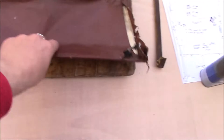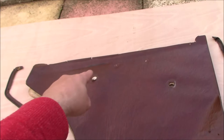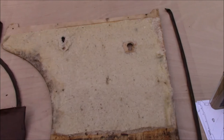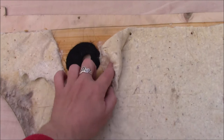Once you've got that off, you're down to your very base fabric — this is the largest piece on the door card. Again, just a few tacks on the bottom, all the tacks around the edge we've already removed, and it's just glued on the top edge. Underneath there is more of your cotton wadding, so that when the fabric's on, it's got a little bit of softness. You've got the door release here, and that one has a felt washer pad. This is completely salvageable and still in really good shape, so I'll be transferring that over to the new boards when I make them.